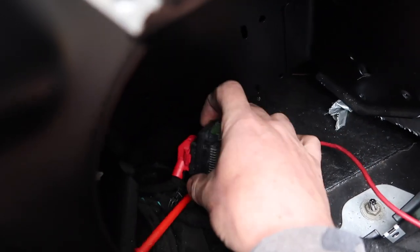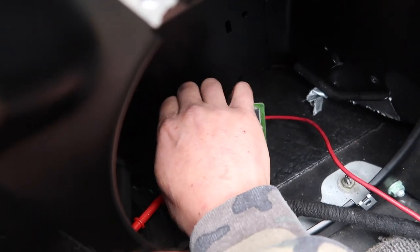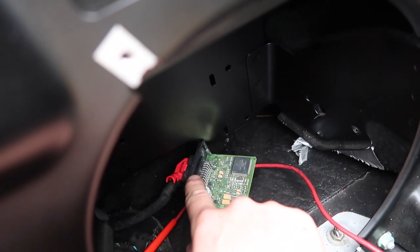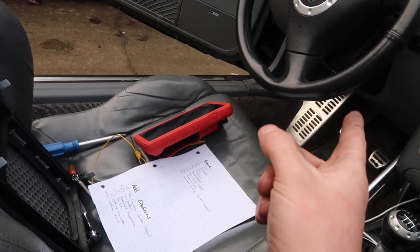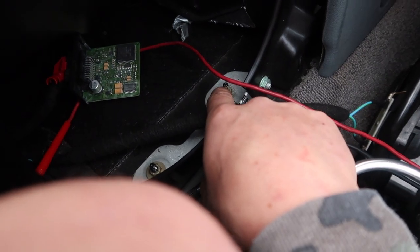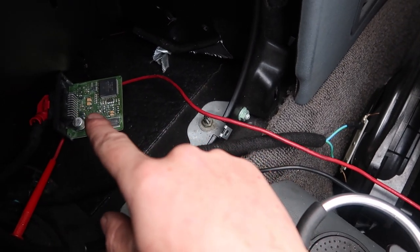It's actually this — if we pull it out of this connector, this red piece comes out of here. We pulled that connector out and checked everything. I pulled the connector away from this board and had it hooked up to the one lone wire it had over here, then checked ground against this bolt right here because this is grounded. And it was fine. But as soon as I plugged the module in, that wire was grounded. So that means this module is grounding itself somewhere in here.